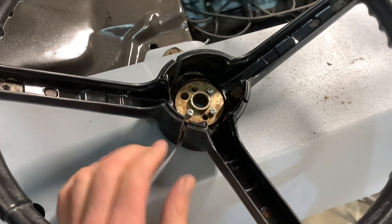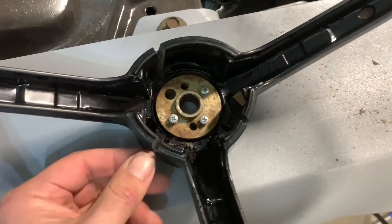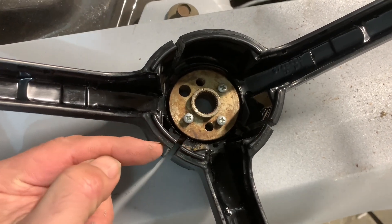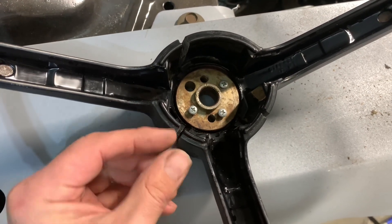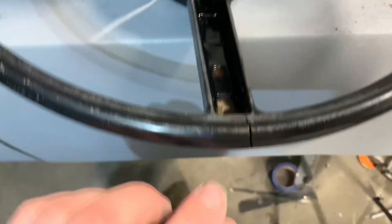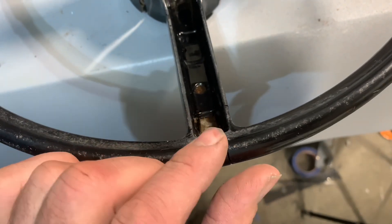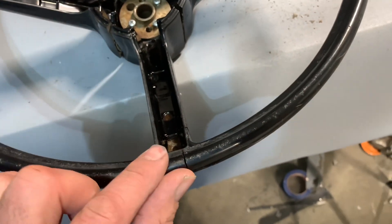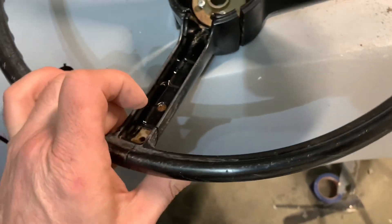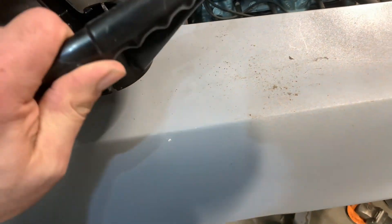Now what we're going to do to prep these cracks and surfaces — I've got a burr bit meant for aluminum, so it's got really wide teeth on it. I'm going to use that to taper back all the cracks, kind of like a V-groove. The idea is, in case this stuff does flex or move around a little bit, there's less chance of cracking right back on that super fine line. Similarly here on the outside edge of the rim, you could try to fill in just the crack, but I'm afraid it may want to flex. So I'm going to V-groove all of this back so when I put my adhesive in there, it'll give more of a bite to hold in place. The same thing with the cracks around the spokes — I'm going to V-groove or V-notch that stuff out.